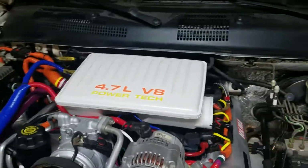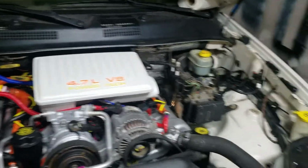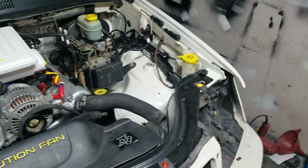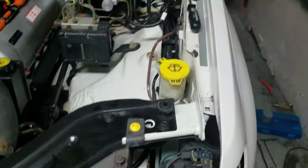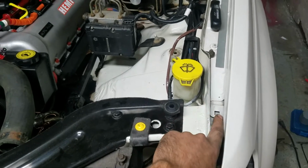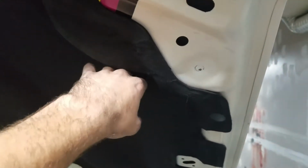I purchased 3 cold air intakes for this Jeep. Hence why I have the factory airbox put back on, is because the cold air intakes were lies. Even K&N says they have a cold air intake, which is absolutely not true. The cold air intake actually is drawing air through this little spot here and running over the fender. So what you actually get is a lot of dirt and crap all over your fender and all over the edge of your hood here from the air being sucked in. And then the other thing is it ends up sucking all the debris off your fire mat.